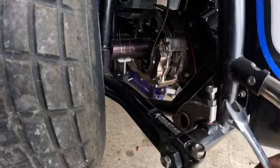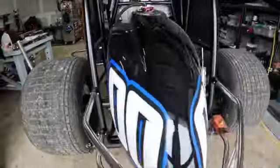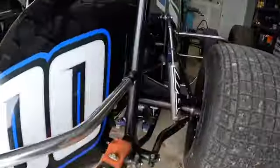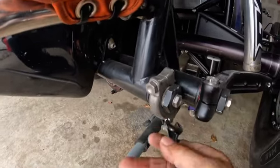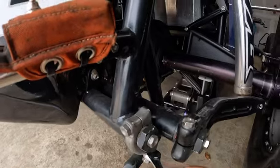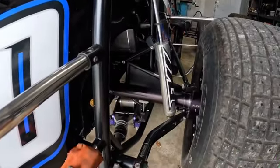We always just kind of set it at neutral, block the car at the shop, take it to the track, and then kind of redo it because stuff settles. So same thing here, just kind of run it up as tight as you can, snug it, and then that's set at block. That way the thing's just kind of level, and we're ready to put a setup on it.